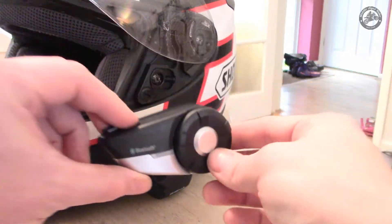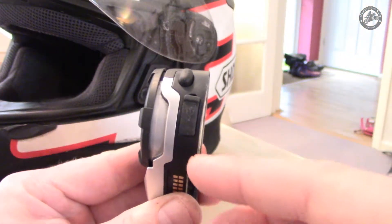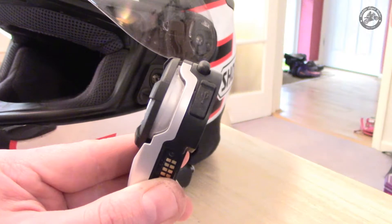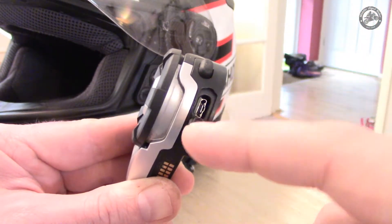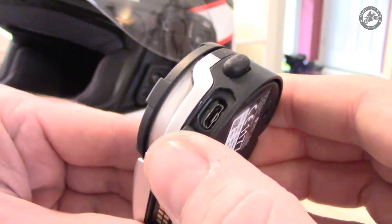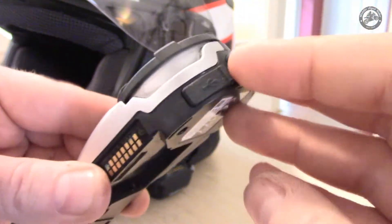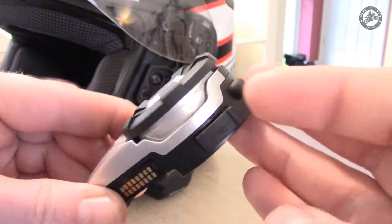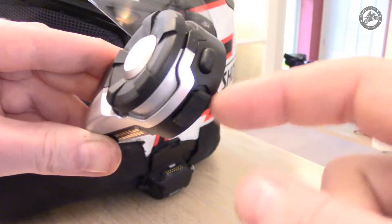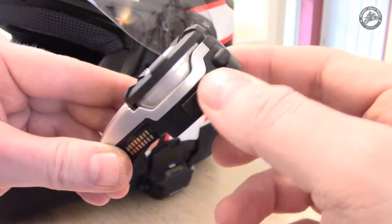You can see that this kind of sits on there, so water comes around here. There's a button here too. This is the USB charging socket. You would expect the rubber boot to flip up from the top, but no — it flips down. So it starts to get a little bit of corrosion inside on the USB connector. It's difficult to get a good fit; the boot tends to flap and pull out in the wind, water comes down and drips in. Just hinging that from the top rather than from the bottom would completely solve that issue — just poor design.